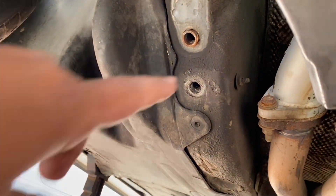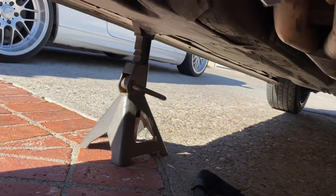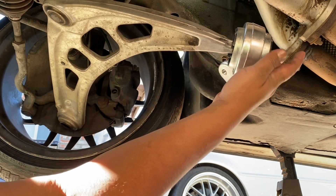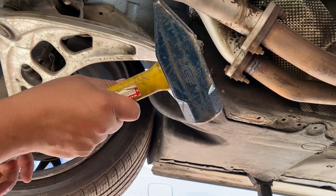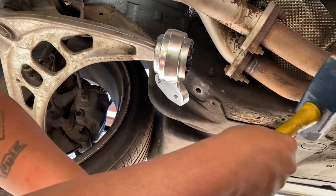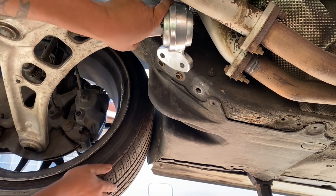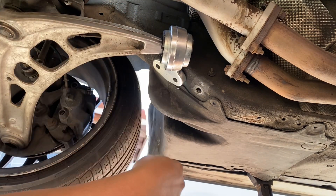I added a little bit of soap on the tip and some inside the bushing — just dish soap, it'll wash off in the rain or through washes. Also, these have dowels here so the holes are guided in, which should help you get them right on there. It's definitely not gonna go in on its own — it's kind of tight — so I'm gonna get the mallet on this. I brought the big boy out. Just give it a couple whacks, make sure it's seated, and she's in flush. That's pretty much all we need.